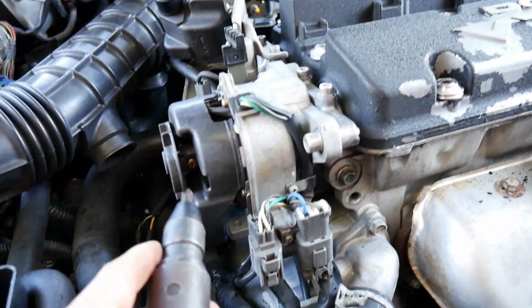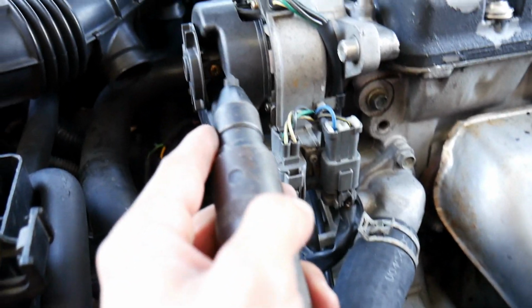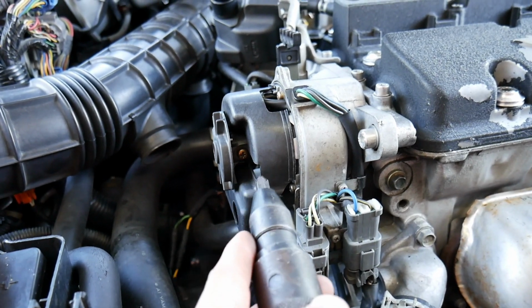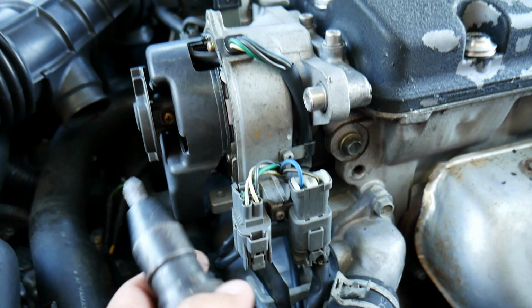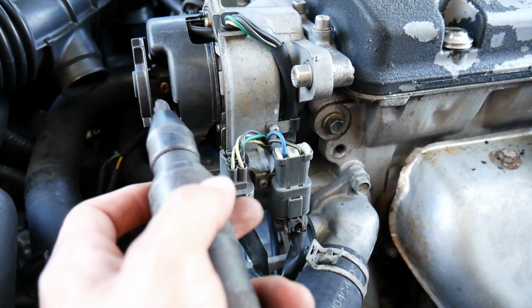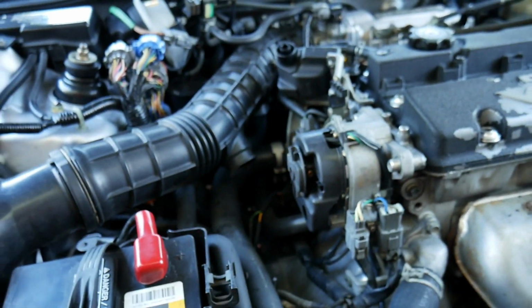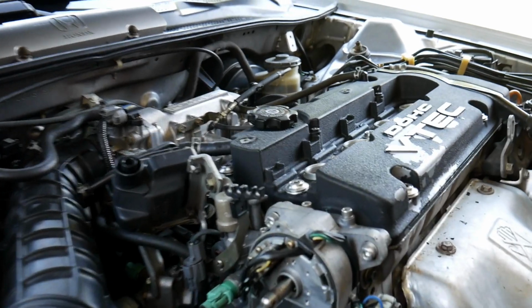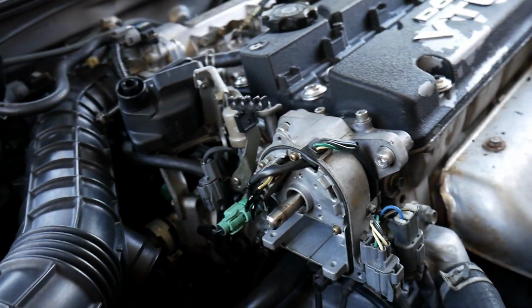Also, if the screw isn't pointing this way, you just turn the engine slowly until it's in the right direction, and so you could get access to it. But see, I'm gonna turn it clockwise, so when I hit it, it turns counterclockwise. So I'm gonna go ahead and try that out. Alright, so it took me about 4 hits with the hammer to finally get this screw off.